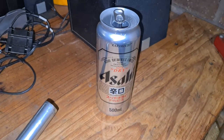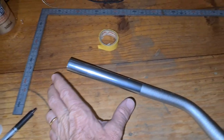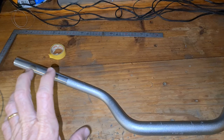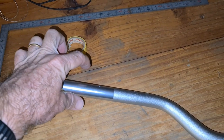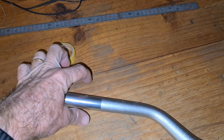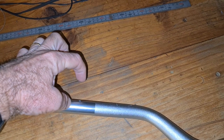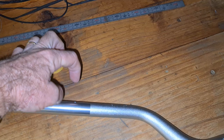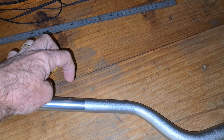Today's video is sponsored by Asahi Superdry — very nice Japanese beer. Now, what I did first was once I mounted the new bars on the bike and got them in the position I wanted, I remounted the switch block exactly in the position I wanted it. Then I got a pencil and made a mark through the hole where the attaching bolt goes through, making a little mark on the bar.